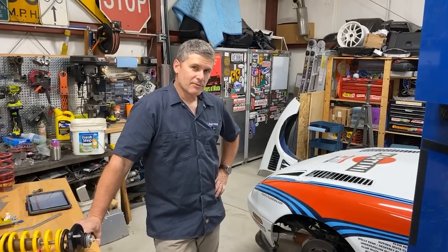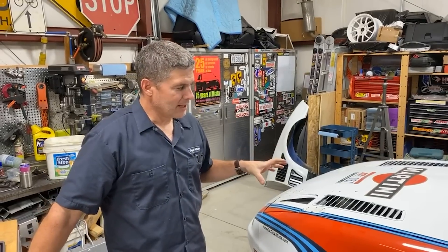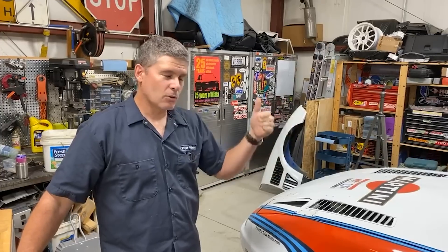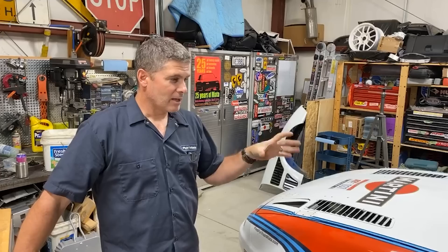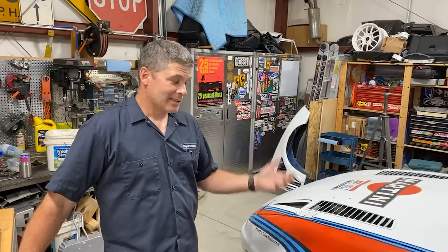Hopefully that was useful. There are a few tips and tricks in there I've developed and learned over the years. The biggest one: you cannot shift weight front to back. I've said this probably six or seven times now, but I cannot emphasize it enough. If you were trying to get more rear weight in a car, lifting the rear up so it looks like an old school dragster is not going to do it. You can only shift weight on the diagonals, from one diagonal to the other. If you adjust all four corners at the same time in opposite directions for each diagonal, you will end up with a car that sits level at the ride height you left it. The car will come into focus much more quickly than if you're just jacking one corner at a time.